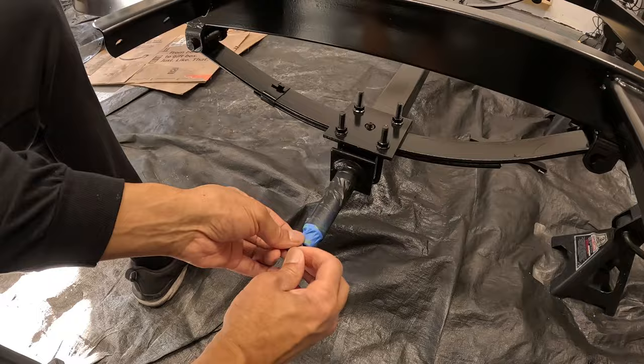The fiberglass resin has completely dried up — I got really busy, so it's been a week. In order to keep this video from being too long, I won't show all the details of carpeting the bunk boards; I'll do a separate video on that. The main thing I need to do right now is get my new hubs on, which I have from E-Trailer. It took over a month to get them in — I think the bad weather was the cause. But if you're doing a project like this, just make sure you order the right ones, because you have to pay attention to the size of everything from your axle to your bearings.